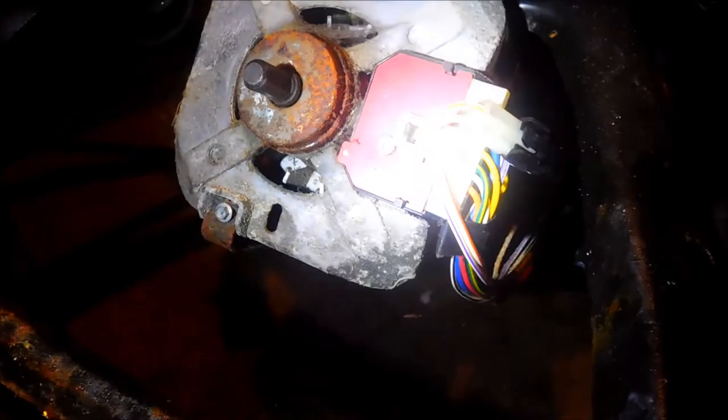It could actually be a bad capacitor. I'll try and spin the motor manually. I may have to replace the capacitor. The start capacitor for the motor is not in the console — it's down on the side. If we take a look at it, we see that there is actually a loose connection here. Basically, this capacitor is shot — that's the problem right there.